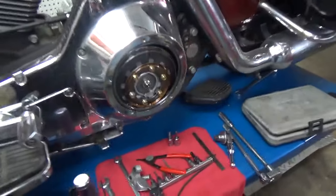We have the lever all lubed. What we have left is the adjustment down here. If we take this clutch lever and pull it all the way back, then turn this adjuster — you can see the lever move. We want to leave about a sixteenth of an inch there. We'll tighten up the lock nut on it. I think that's going to make Brother John rather happy — sure easier than replacing that cable.